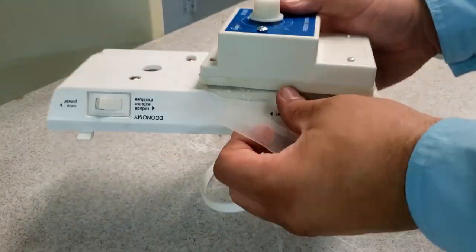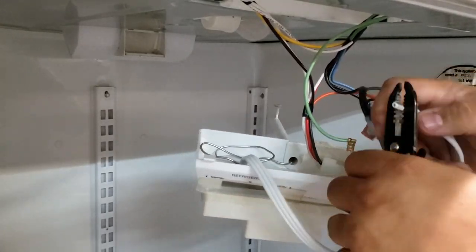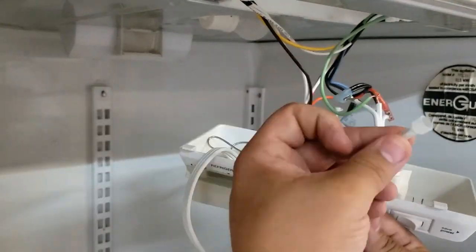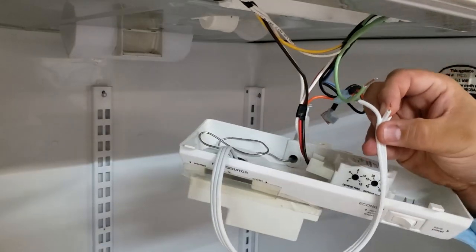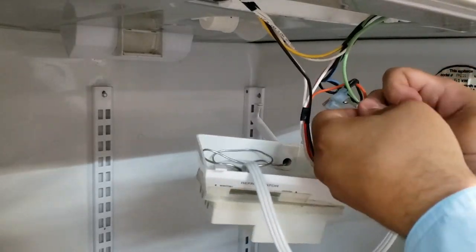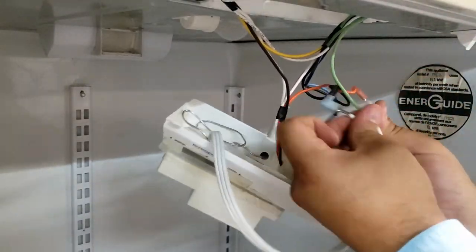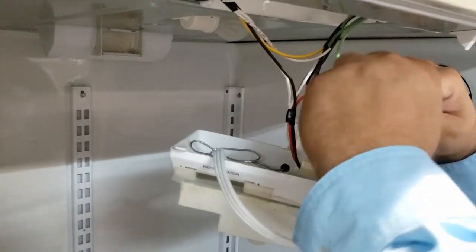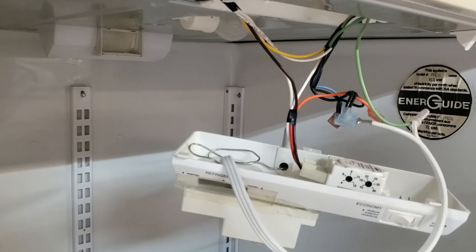Now we're reinstalling the control housing back into the refrigerator. The wires are easy to put back except for the ground wire — the refrigerator had a 90-degree spade connector while the new Supco cold control wire pack had a ring-shaped ground connector. To fix this I used a clamping wire nut to join the two ground wires together. Once the clamp is used, add silicone sealant to the end of the nut so moisture from the freezer can't get into the spliced wires. This is quicker than a splicing butt connector and you don't need to heat-shrink the wires.